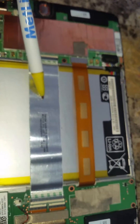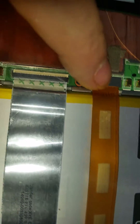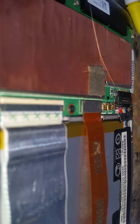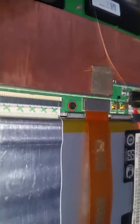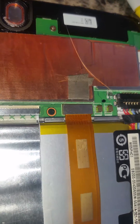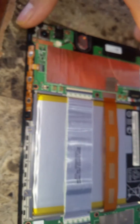They had made a comment about this ribbon cable being loose. This ribbon cable is the charging supply running from the daughter board to the motherboard; the other one is for the digitizer and screen. What I noticed is that this connection can rock back and forth — it's a very poor connection — and if it isn't perfectly straight on there, your unit will not charge.